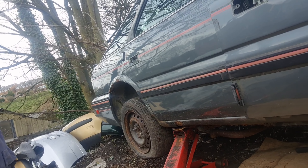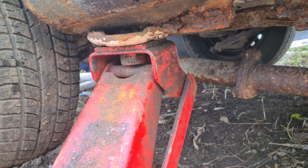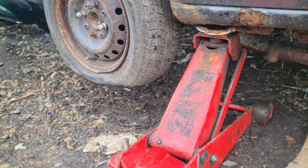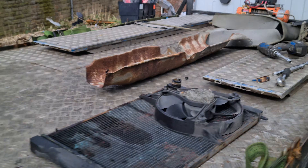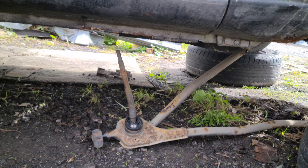It's quite a long heat shield on this. The slightly sketchy part is jacking this back end up so I can get under there underneath that sill, which from experience I know isn't really worthwhile climbing underneath unless you can put something else underneath it. Making some progress — there we go, big chunk of exhaust out, and the heat shield, and now the gear linkage is released as well.